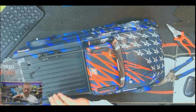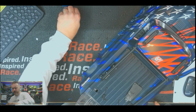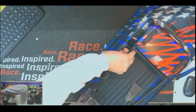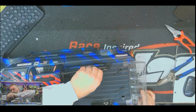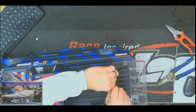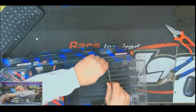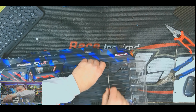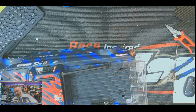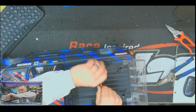I've got that one on there — that's looking good. It's screwed right up. I'm using 3x6 flathead screws. These are some I bought off Amazon — they're stainless steel, and they're terrible. Anytime they get even slightly cross-threaded, they easily break off. They're not strong. So I don't use them on anything structural — steering, suspension, stuff like that. I've kind of stopped using stainless. I realize the black screws are actually stronger; the steel ones are actually a better metal.